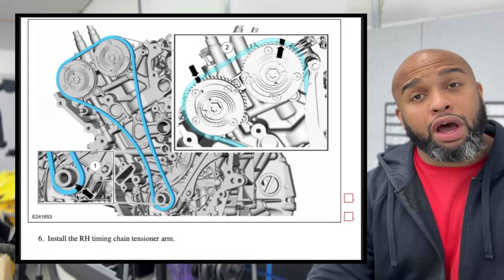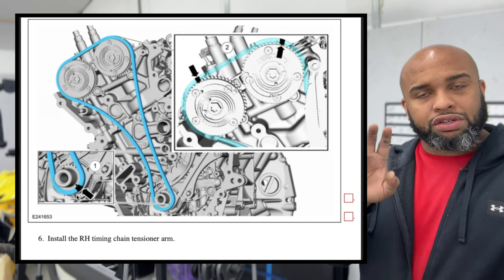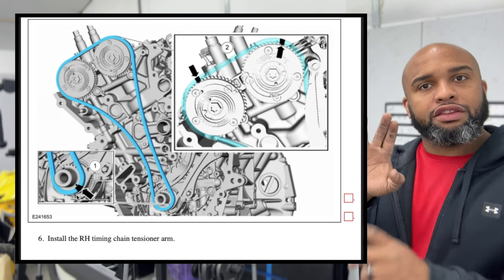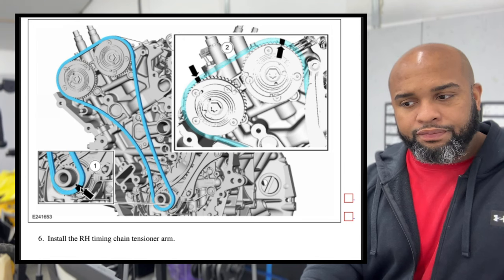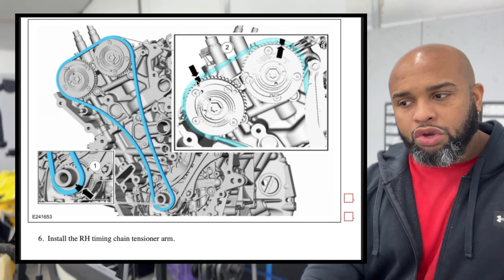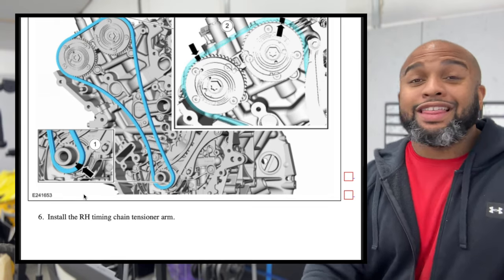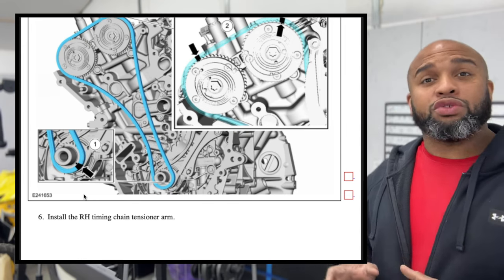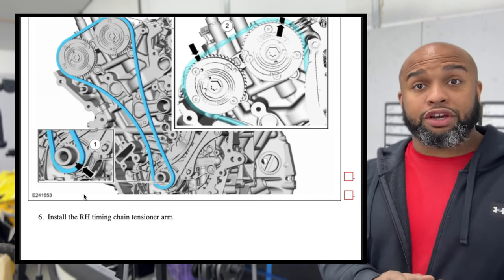And then down on the very bottom, there are two copper colored links. And so each link has two teeth on it. So there's gonna be four teeth. This one sits in the middle of that. So right here it will have one full link on this side, one full link on this side, to where these will have one link in the dots splitting the middle, and this one is in the middle of the two links. So make sure you have it just like that. Then you can pull your pin out, release the tension, and that side is good. You want to do the driver's side first because it's offset back, and then you'll do the passenger side, and then you should be good to go.